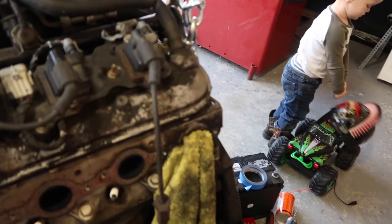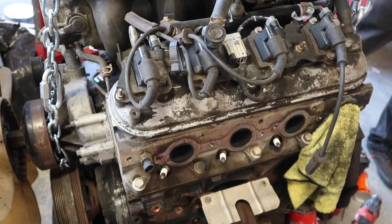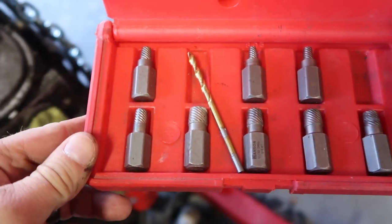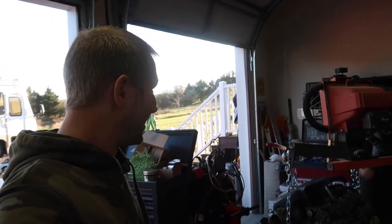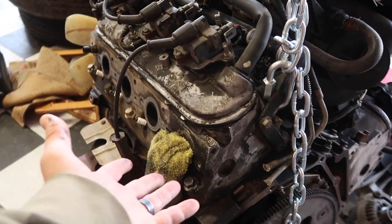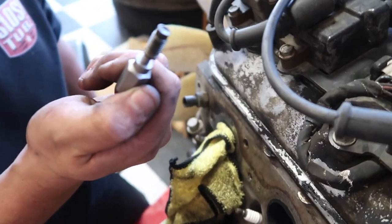There you go — that's pretty much how to get a broken bolt out. Especially bolts when they break off in your block, it can become very very scary, but if you just take your time with it you can pretty much do it. This is the kit that we just used — not sponsored, but it definitely works. It's like 100 years old, Clay got it at the flea market. We had three broken bolts, got one out already, just got that one out which you guys just watched. We got one more — go clockwise this time to remove the extractor and it comes right out. So easy — doesn't even look like we used it, still looks perfect.